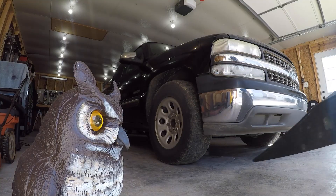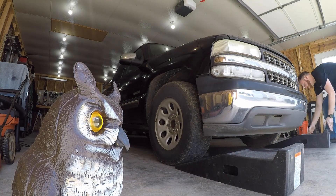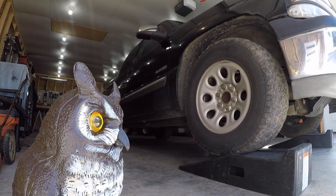Now, I'm hopeful that this may fix the problem, but I'm also doubtful because with this many miles on the truck and with the color of the transmission fluid, more than likely the band is completely smoked or something has broken internally. It is kind of well known that those bands do have problems with cracking from time to time. So the first thing I need to do is get this truck up in the air, pop the servo cover off, and maybe I'll get lucky.